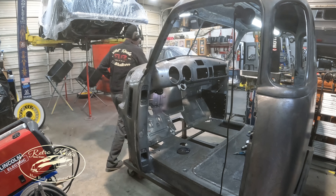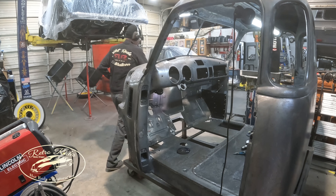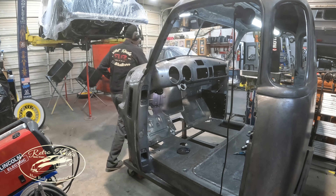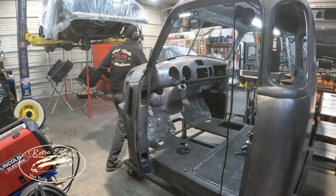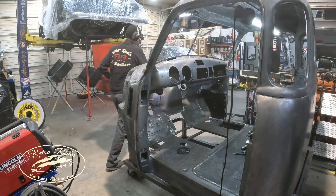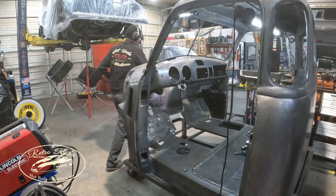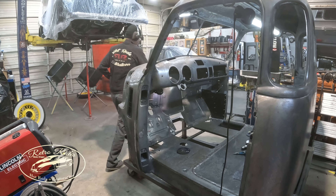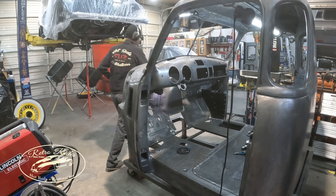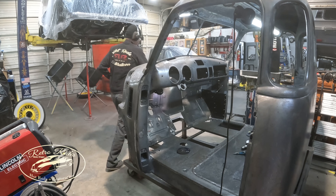Like you were pointing out earlier, the bottom of that hinge pocket — yeah, this part here — it's all rotten as well. I think we have replacement bottom pockets. At least they make everything for this rig. It's got to be a rust repair on it for sure, but it's all fixable. I'll just start cutting out that kick panel, get that fit, and then we'll go from there. We do have new door hinges for it, and we have the newer style bear claw latches also en route. So get all that stuff buttoned up, get the door bolted on, make sure everything's nice and square with good gaps. So — rust repair — it begins.